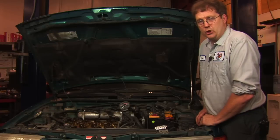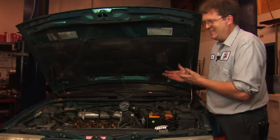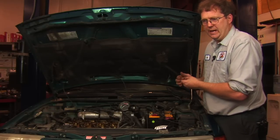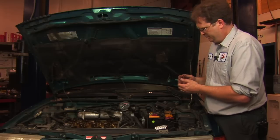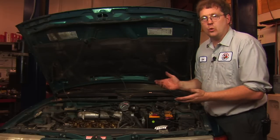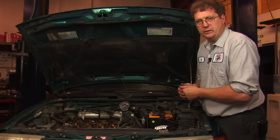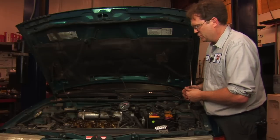I've hooked up a remote starter switch, and while it cranks over we'll watch to see if there's some evidence of vacuum. There does seem to be. So this could be one easy way of telling if we potentially had a problem with the timing belt. There are other reasons why an engine could have low vacuum, but if engine vacuum is present, we know it is working as a pump and that part is good.